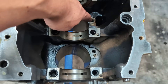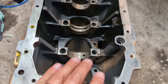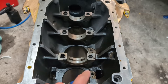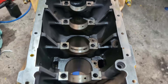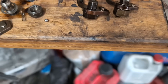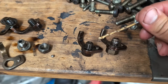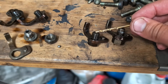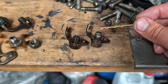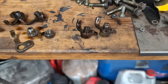There are also oil jets — or oil nozzles — that spray the cylinder walls as the pistons and rods travel up and down. These nozzles are a very common failure point and will immediately lower your oil pressure. I have two here to show: one from a T5 engine — also known as the Saab 9000 and early 9-3s and 900s using the Trionic 5 system — and one for a newer Saab 9-5 and 9-3 with the Trionic 7 system. They work the same way; the design is just slightly different.